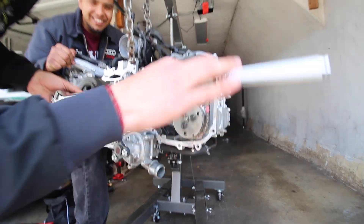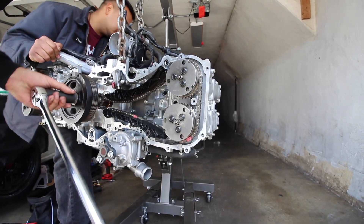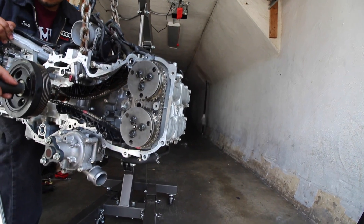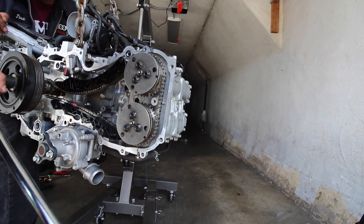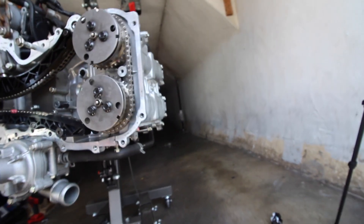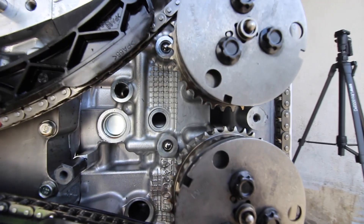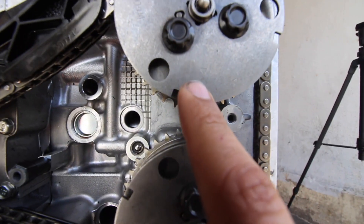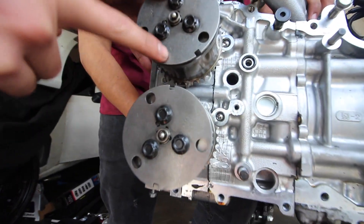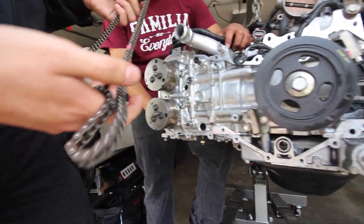We should spin it backwards and double check — that should be two turns, right? So we had to turn the crank to get that mark and that mark to line up, so that way we can time this side. What we have to do is have these two pointing at each other. Once we have these two pointing at each other — same thing as the other side — line up the pinks with the notches on the top, and then the blue one should line up with the timing mark on the crank. Pretty simple.